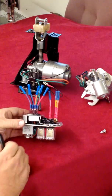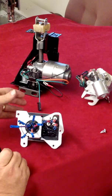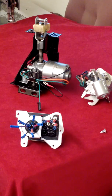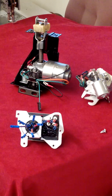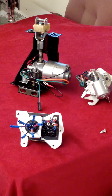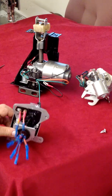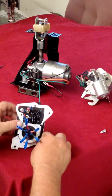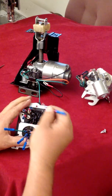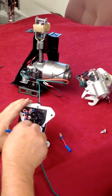There's one other part to this system that we did not have, which the owner verified works properly, and that's actually the motor which raises the trunk lid. There's three components that this relay has to control, along with limit switches, which tell this unit here when to stop feeding power to the other units. And at this point here, we're going to verify the operation of this unit that we've constructed, and we're going to do it through the manual. The manual tells us that to verify operation, what we do is plug in a power feed to the feed going into the relay.